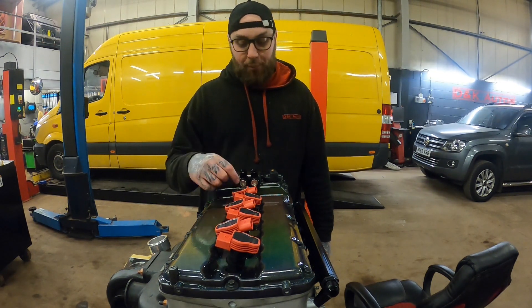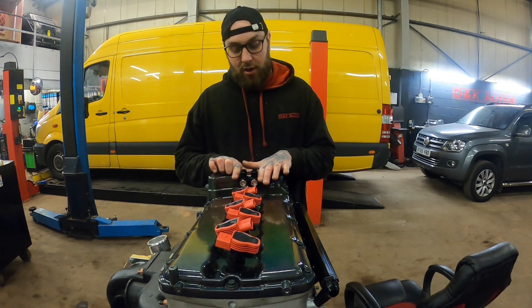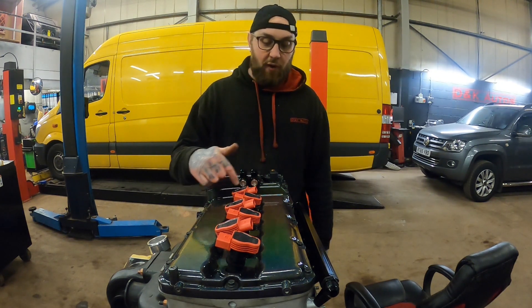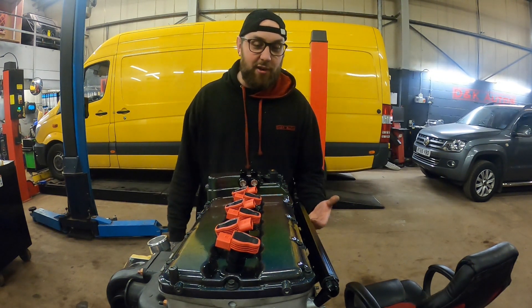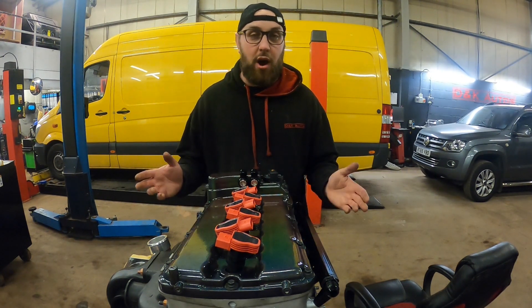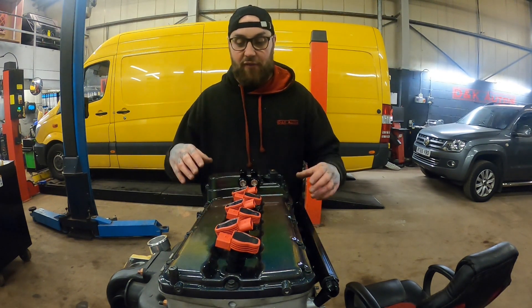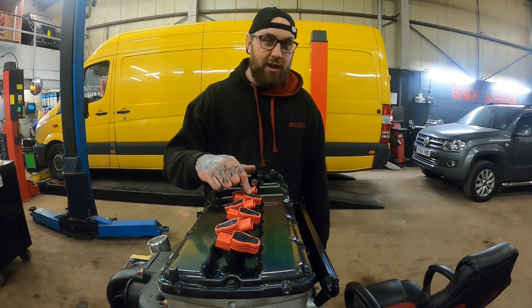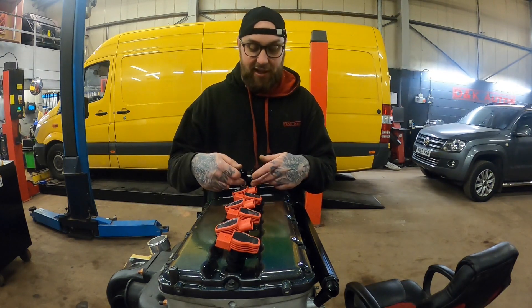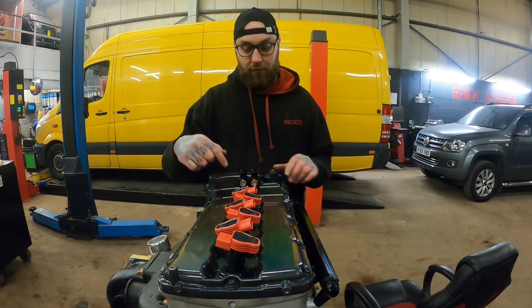The problem was when I looked at where the coil pack plug sits — on the normal coil packs the plug is directly on top — I realised when I put the plug on it was going to interfere with those fittings coming straight out. I was going to go with right angle fittings anyway — the R8 ones with the right angle and the red, they look nice. There is apparently a performance benefit to R8 coil packs, though I mainly bought them because they look better and will be cleaner coming off to the sides rather than sticking straight up. They're not more expensive than normal ones either. But I thought the right angle would sit down and clear the fittings — I was wrong, they still stick up.